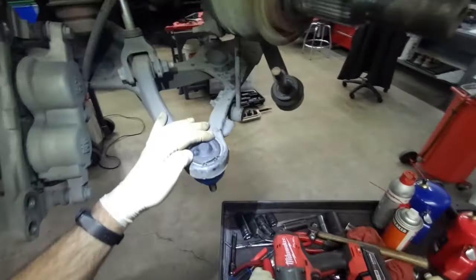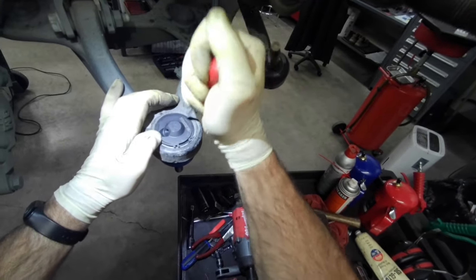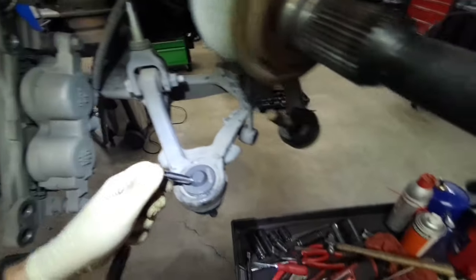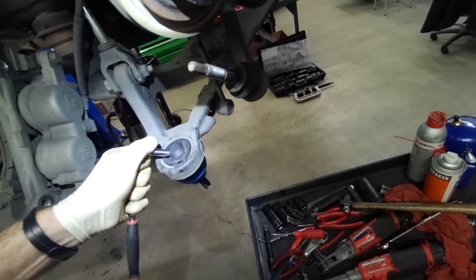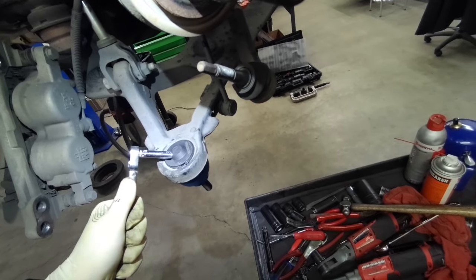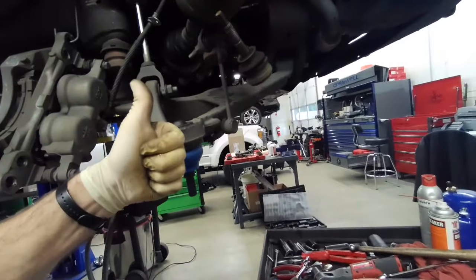The snap ring on the lower ball joints really doesn't do anything anyway — all your force is up. Even if you didn't put a snap ring in it, I don't think that ball joint would ever go anywhere. Install the grease zerk. These ball joints are done — just reassemble it and grease it. Shouldn't even have to align it. Thanks for watching everyone, we'll see you in the next video.